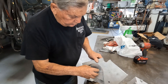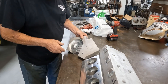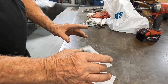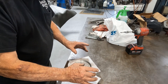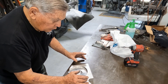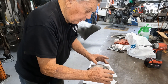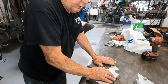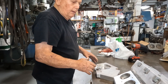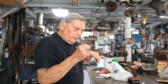This takes a Chevy timing chain from the crank to an idler here, and then we run the belts from there. On this one we're going to put an idler on each side of the belt so we'll be able to adjust cam timing by moving these two idlers. Pull the cams ahead to advance the cams, or the other way to retard — we can do this on a dyno just by loosening these idlers and playing with cam timing without touching the five bolts on each cam.